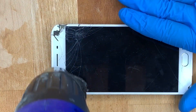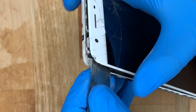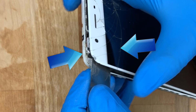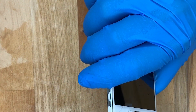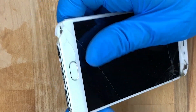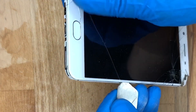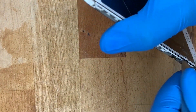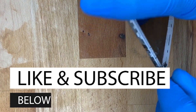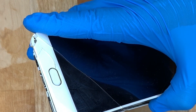You can't really damage the screen any more than it already is, so don't worry about burning it — but still don't burn anything underneath. I'm using the iOpen tool to get in between the actual screen and the mid-frame, slowly moving it around. It looks a bit awkward but it's a very easy phone to repair — it slowly pries off and then you slide the cables through the mid-frame.